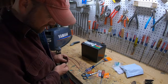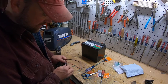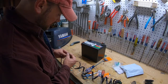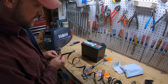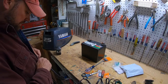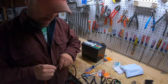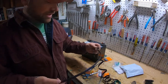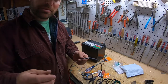I was happy Home Depot had this wire. They had landscaping wire that could have worked but it's solid copper. This wire has stranded copper, which from anything I've done on cars I've always preferred stranded over solid. I'm basically matching the same wire that's already on the regulator. I'll put the heat shrink on, pick it up, and come back when the connectors are on.